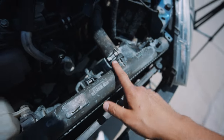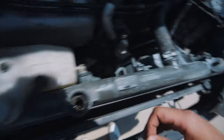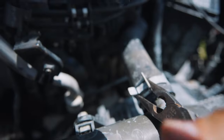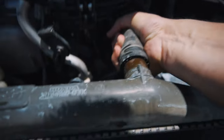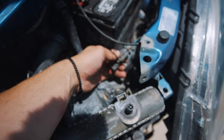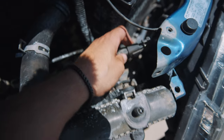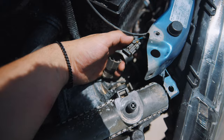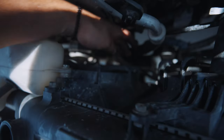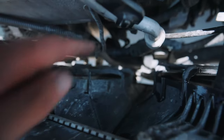We now have access to the upper hose. I'm probably going to end up taking off the hose, maybe the reservoir, and maybe the fan — I'll see what I have to take off to remove this piece. We have the plug for the fan on the driver's side. It's a little bit tricky — just push it from both sides and separate it. For the harness plug for the passenger side fan, you get it from the bottom. You'll see it once you're looking under the car. Make sure you disconnect both.